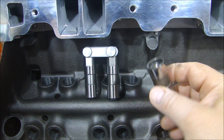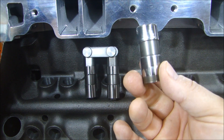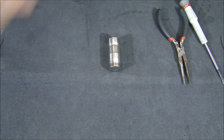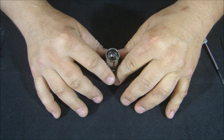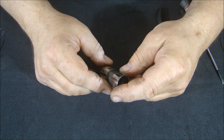Cleanliness when installing these is very important. Let's take this apart and I'll show you what happens with that hydraulic assembly, why it's called hydraulic, and how it pumps oil to the top. If you're rebuilding your engine and just cleaning your lifters, if they're in good shape that's perfectly fine. You don't need any special tools — just some needle nose pliers and a screwdriver.